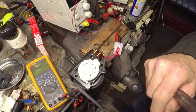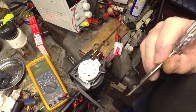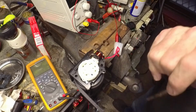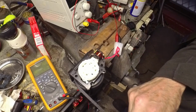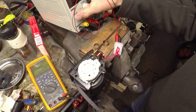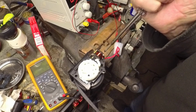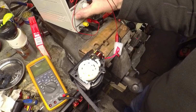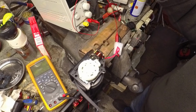So that's quite neat, I think, that you're using such a small force on this small plastic pawl to get the initial lock. But as soon as any real force is applied, then these metallic pawls kick in and do the real work. So if I release the pressure again, put the power on, that pawl is pulled out and we're back to free. But take the power off, solenoid opens and we're back to locked.